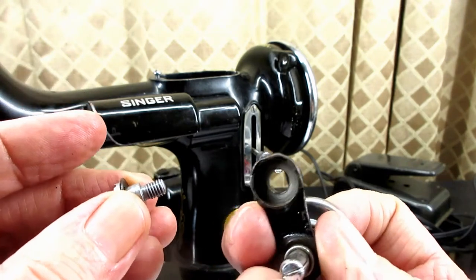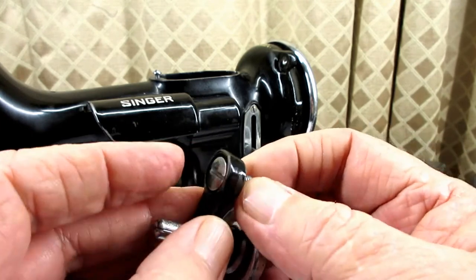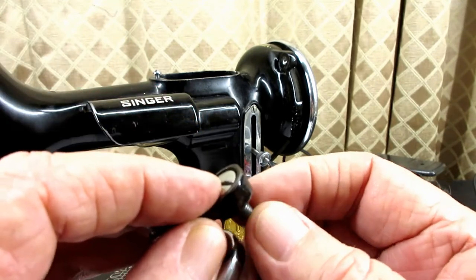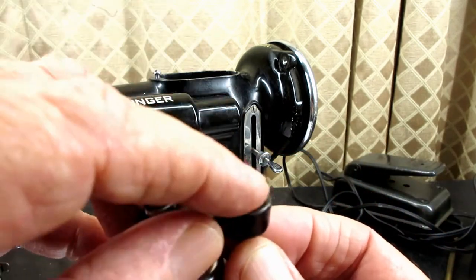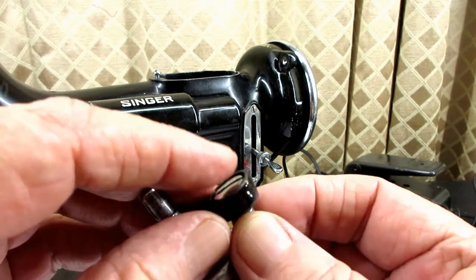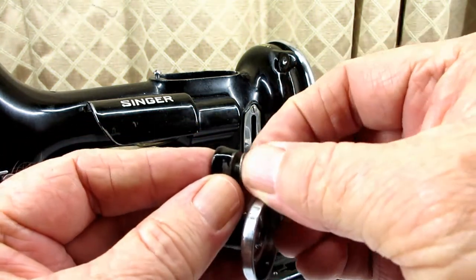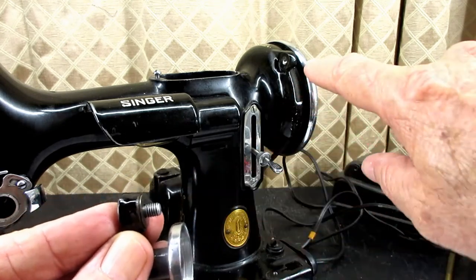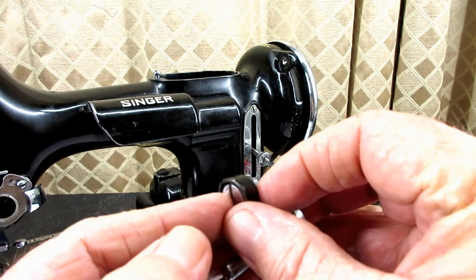What you put in the recess retaining area is the hinge screw and the friction washer. You want to be sure to get it flat in there - it can get a little crooked and you'll think it's seated when it's not, so tightening it won't work properly. When it's in there properly it's recessed below the edge of that area, nice and deep. Then the flat washer just goes on there to take the wear between the bobbin winder frame and the ear where you mount it. It's a good design.